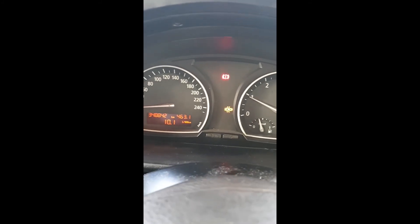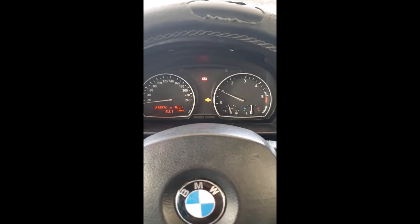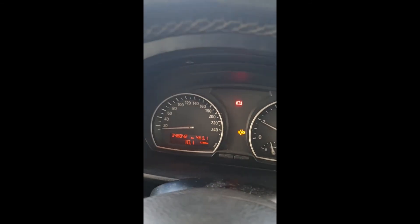You would have noticed the airbag alarm has gone off — and it's now gone. No need to reset it with a computer, no need to go to a software guy. For my particular car, no need to bypass the seat belt sensor either. There is a wire going to the pretensioner piston for tightening the seat belt in an accident, but no actual seat belt occupancy sensor. For the 2005 BMW there were only two connections under the seat: the seat belt restraint system and the mat sensor. Make the mat sensor healthy and the alarm is gone — and I'm not getting any seat belt alarms either.